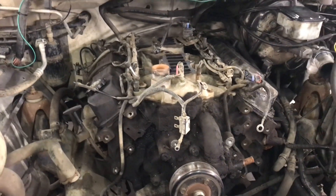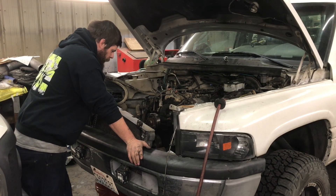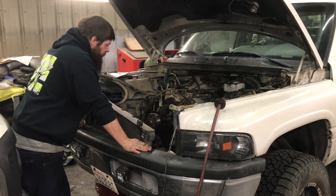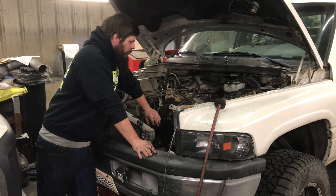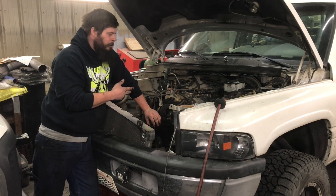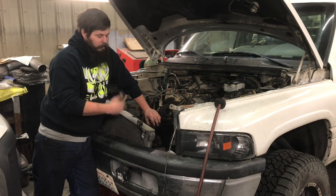I have this innate ability to break anything. A while ago I did a video talking about breaking off one of the rocker assemblies — it's a notorious thing these trucks do. Up until 1998, they used a 5/16ths bolt for the rockers. They realized this was a problem, and in later trucks up until 2003, they upgraded the heads to a 3/8th bolt. Then they quit breaking the rockers.